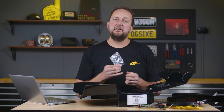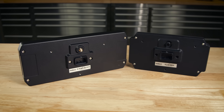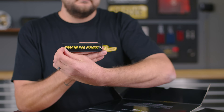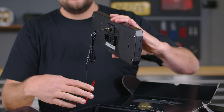We've got three mounting screws. Something interesting to note is that the IC7 and the UC10 have the same mounting footprint — the three screws that hold them in. The UC10 is physically a larger dash, but the mounting bracket is exactly the same. So if you've got one of those aluminum brackets on your steering column, you can use the same three bolts to screw a UC10 where an IC7 once was. We've also got a Wi-Fi antenna that goes onto the back of the dash — you can program the dash, get data logs in and out, and change configurations all via the Wi-Fi communications network. That's everything that comes in the box to mount the dash, configure it, and plug it into your engine management system.